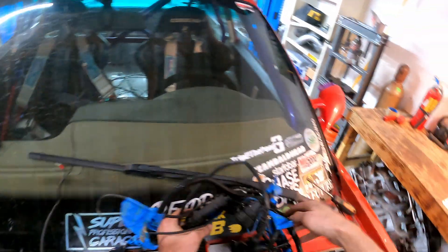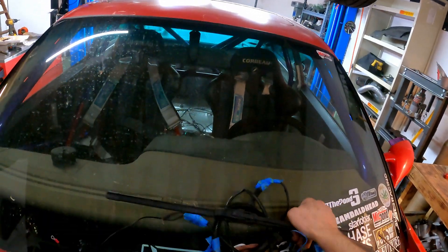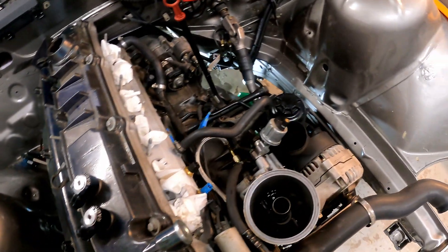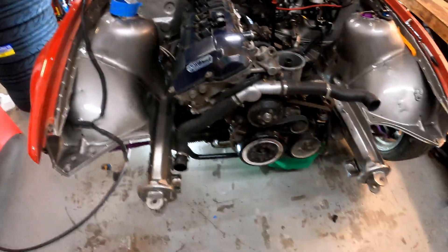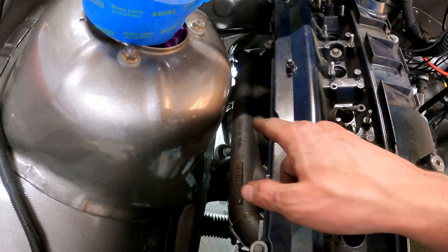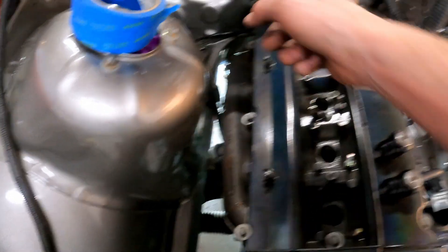What I like to do is set it up top and grab it with the windshield wiper. Got a chain up to it now. Get rid of wastegate lines. We should be ready to turn this thing kind of vertical and start walking it out that way we don't have to deal with the steering shaft. This time I'm going to try and leave the whole turbo and just get rid of the wastegate lines and my wastegate relocation pipe, which runs down from right here.